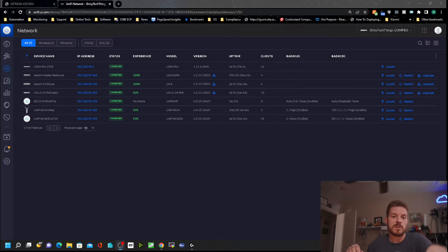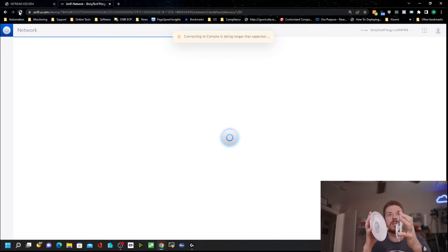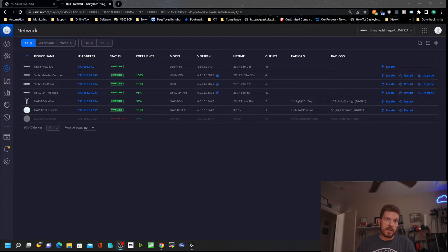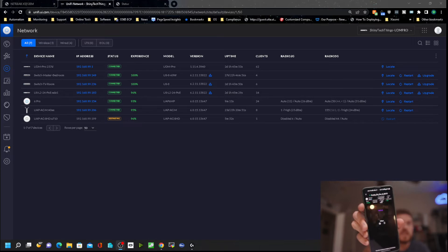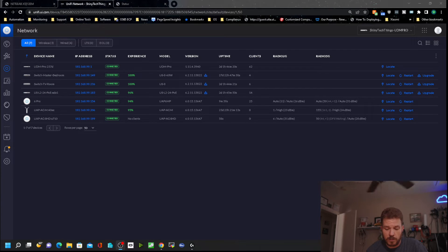Let's go ahead and take a look at it. It is up. I'll bounce to the Wi-Fi on my phone and see if I can connect to it. In comparison to the AP-AC Lite, this is a lot easier to crack open - all plastic versus the UniFi 6 Pro where the base is metal and the top is still plastic. The internet is back up, so I'm going to try to run a speed test. That is pretty freaking insane - 903.7 megabits down and 34.9 up. That is impressive. I am using 160 megahertz width on the 5 gigahertz channel.